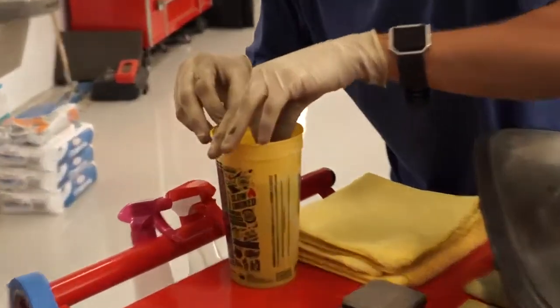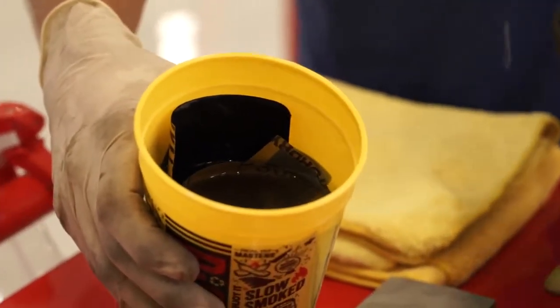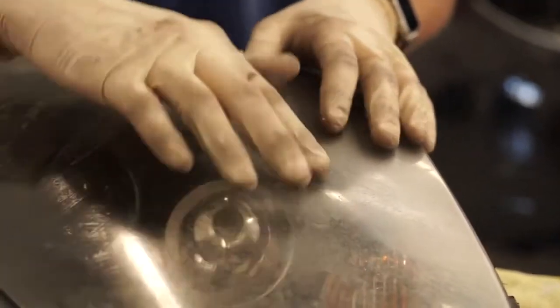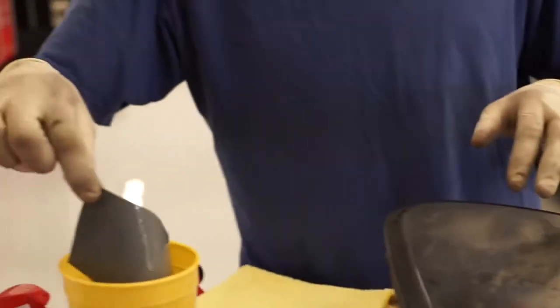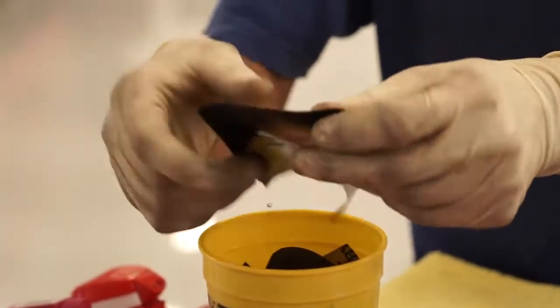And then you're going to need several different sandpapers. The best thing to do before you start this is soak your sandpaper. Otherwise it's going to be real rough and rigid, and what it'll do is it'll crease, and you can get valleys. It'll bite a little too hard with that harder edge. So the best thing to do is just let it soak in water for about 5 or 10 minutes, and then you can see they're far more pliable at this point.